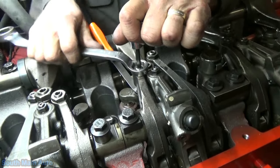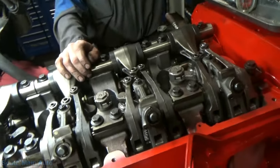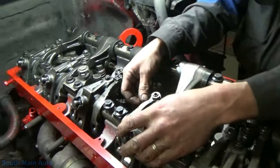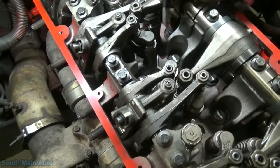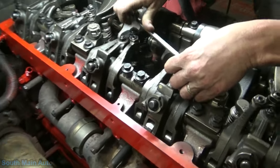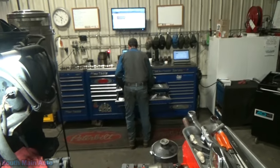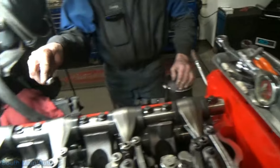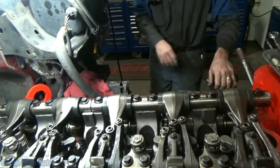You were saying these engines are pretty notorious for not making it past half a million miles. Yeah, Cummins had a lot of issues with the heads and sleeves. The sleeve that you showed everybody a picture of — grab a 13mm — that was Cummins' downfall. Most big diesel engines have the block retaining the sleeve pretty much to the base, but on the ISX the top portion of the sleeve is retained in the block and all of the bottom hangs into the oil pan.